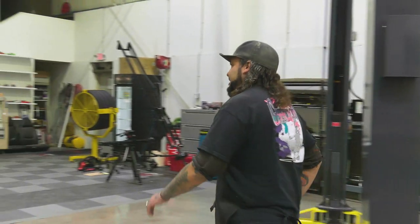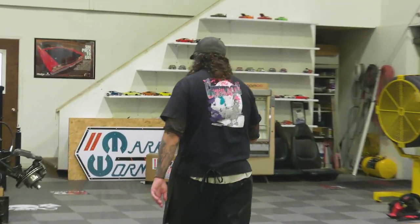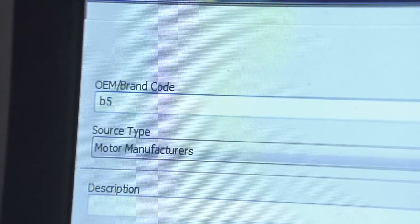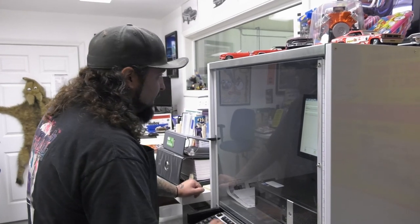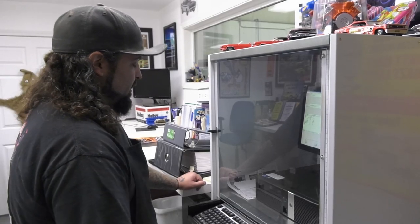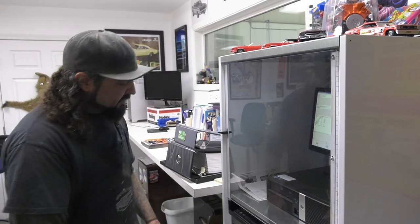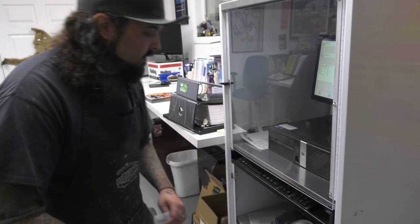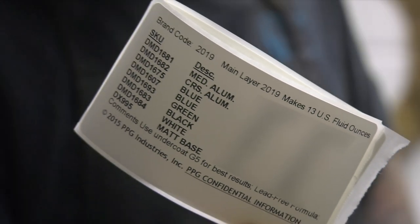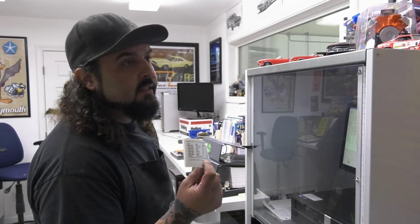One of the first things we do before we even paint a car is we've got to make sure the color is correct. So I'll head into the reference room, type in B5, get the little label that tells me exactly what's in it. So right now in the reference room, jumping on the computer, typing in B5 and getting ready to print out a label so I can go back and make some color. I use this all the time, mainly when it's a color I haven't done before. Some colors like the FC7 — the ones we do a lot — we know are good. But when it's the first time doing a color, I just come in here, mix it up, print out a little label, and it tells you exactly what goes in it and what to do.